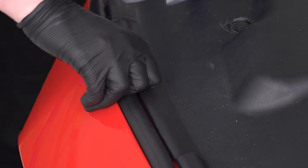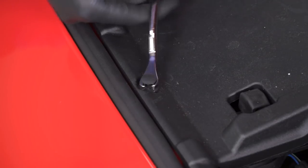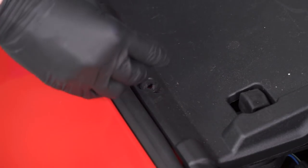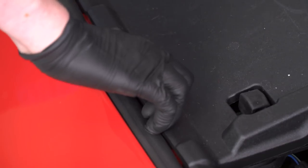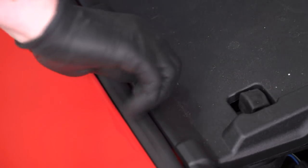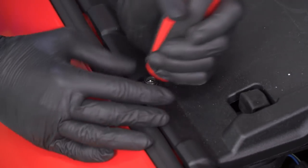As a side note, I do wanna mention that technically this will fit the EcoBoost Mustang, but it's not really recommended for it because of the front mount and it does slightly increase intake air temps in some cases. Now, it's not gonna adversely affect the drivability of the car or its performance, but that's why you don't see it listed as being for the EcoBoost.